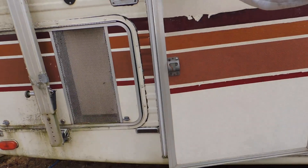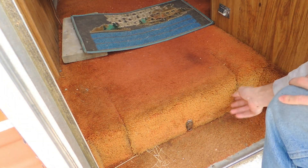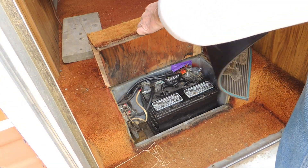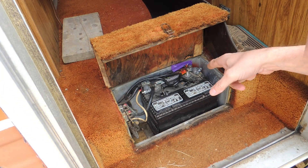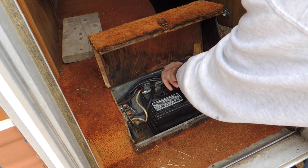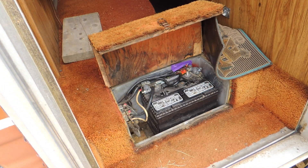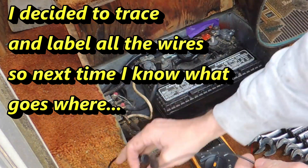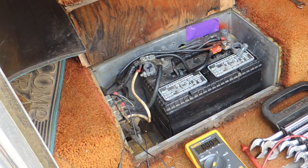We're still at 100% — let's put it in the camper. We finally have a nice day. In my camper, the main battery is here; there's also one under the hood. This is a terrible setup — there's no way to hold the flap open. Here's our group 24. One of the wires on the positive goes to the battery up front. I'm going to unhook the front battery, unplug the charger, make sure there are no electrics anywhere, and do the wires one by one.